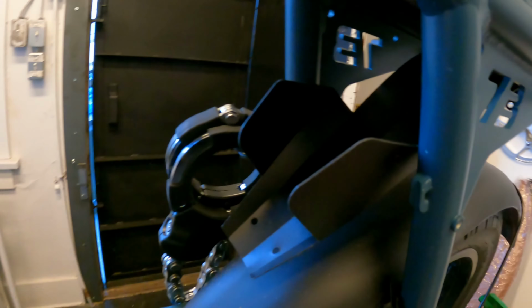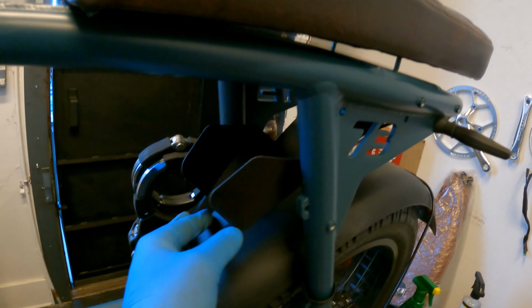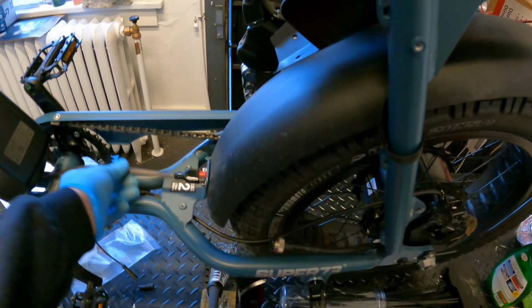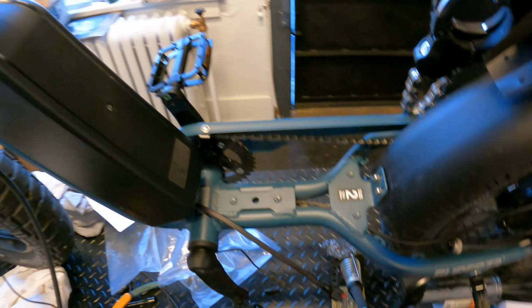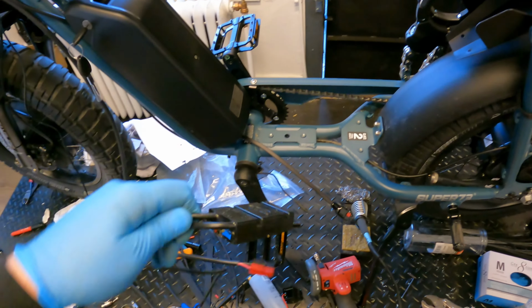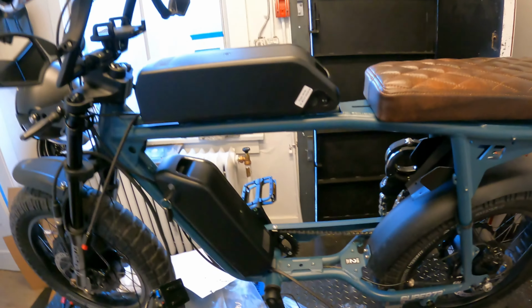And then underneath here, of course, we're gonna be doing something a little bit different. This maybe uses a cover still, but we're definitely gonna have some more cool stuff underneath there, and hooking up the rear motor along with the rest of the stuff. There's some more wiring down here. And then along with that, we'll be installing the DC to DC converter from Grin Technologies. This one's adjustable, and we're able to hook this up to the battery power and reduce it down to 12 volts for all the lighting system and signals and whatnot.